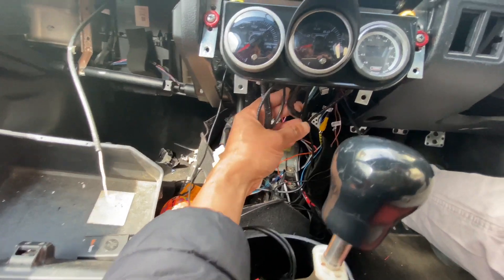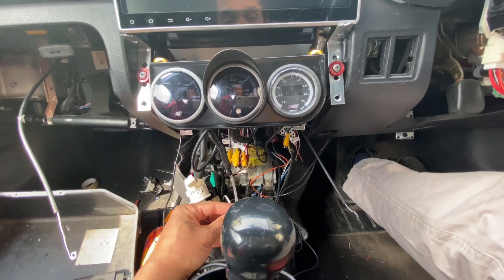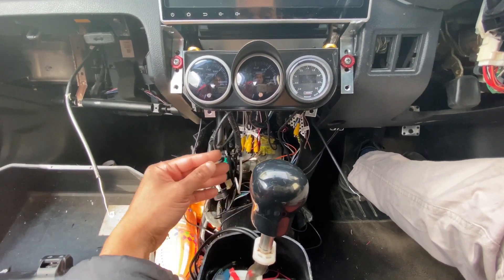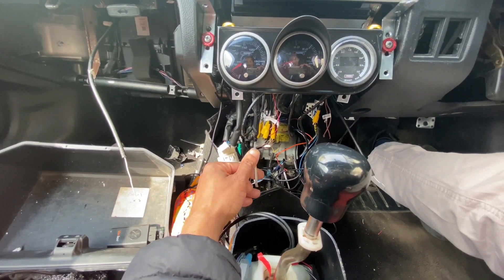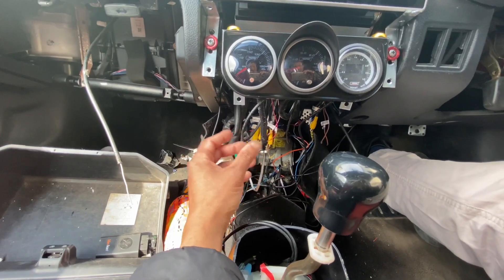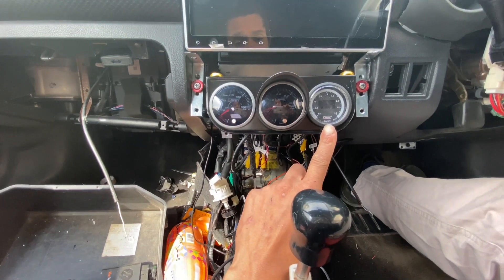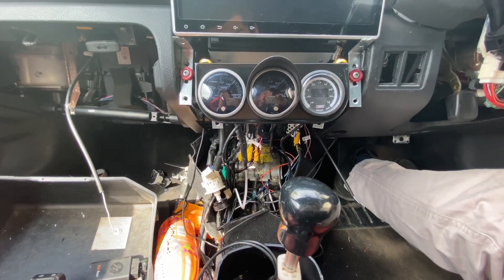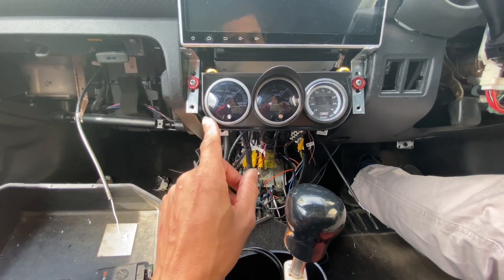What I did to connect them - I extended all the wires because they were way too short. Here's one, there's another one, and there's another one. I had to extend them for about a meter or so. Normally you should connect those to permanent live, and then there's one for the ignition switch. At this stage I connected the power just to the ignition live for those two, and this one is mounted correctly to the permanent live as well.